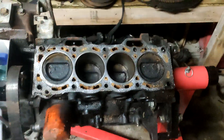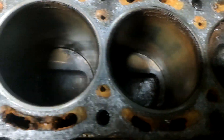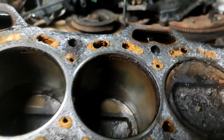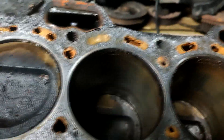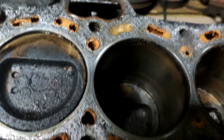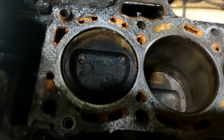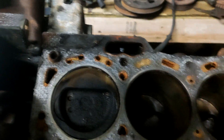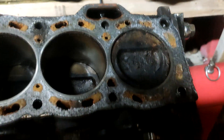So I've taken off the head and had a look at all the bores. The engine is in not too bad condition — there's a little bit of rust that's formed on the bores, but the overall bores haven't got any deep or scary scratches, which means the piston rings are not in bad condition. There's a lot of carbon build-up on top of the pistons, and the head gasket is mounted on there, so I'll have to get it all off and then get the bottom end skimmed.